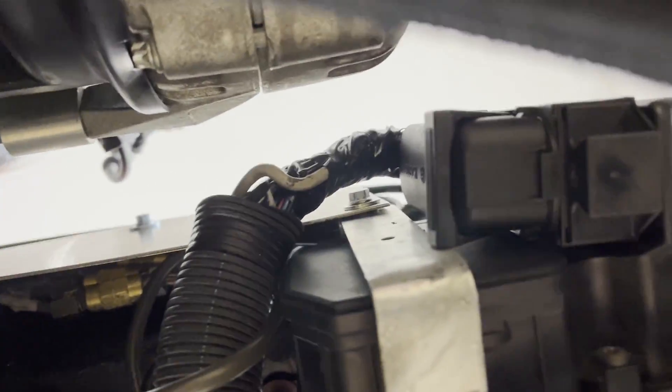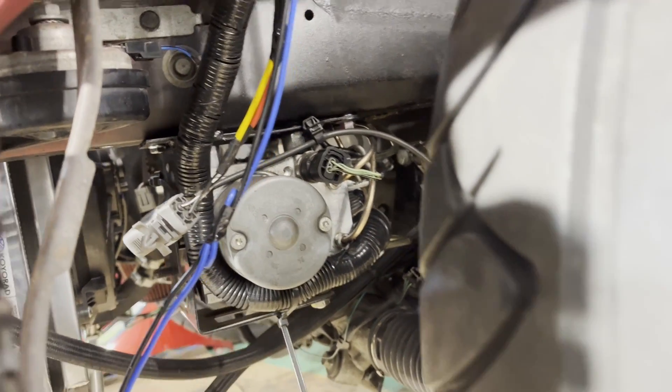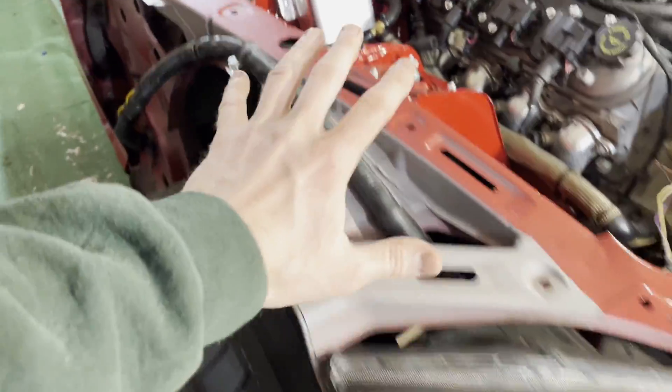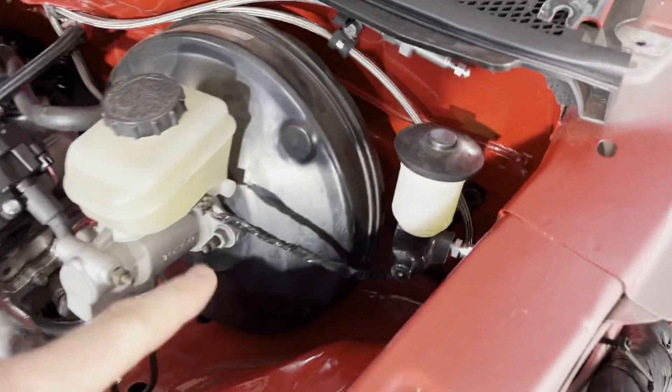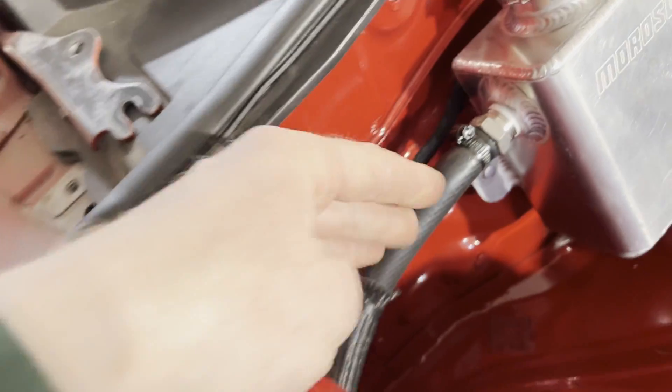Got my ABS plug up there — all like 40 wires were extended, wraps around and back up, should dodge everything in there. I'm going to make a nice cover plate for the brake lines, ABS module, and whatnot. Checked all my headlights and blinkers — they work. Passenger side was already done, slightly smaller loom. Got my brake master cylinder plug extended and my Mazda coolant temp sensor in.